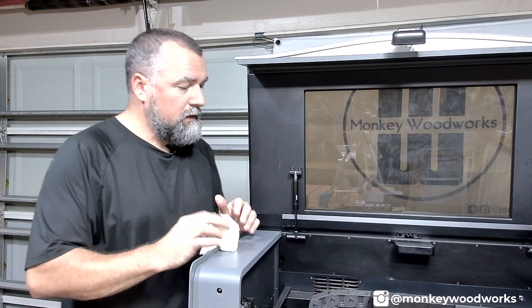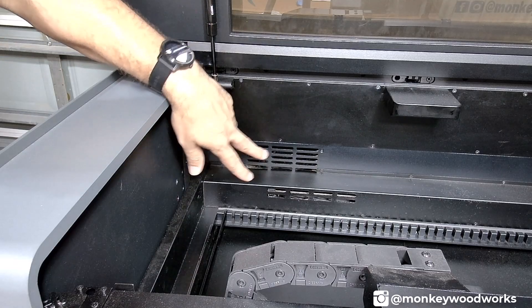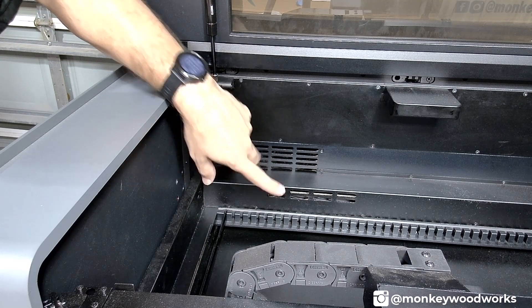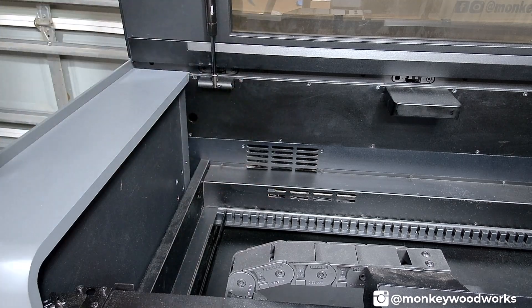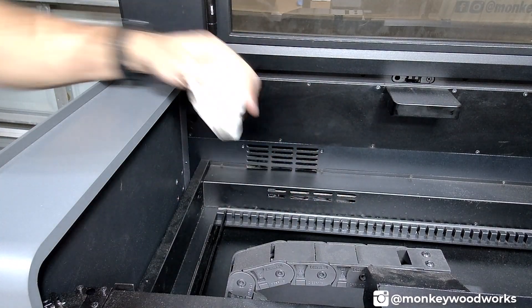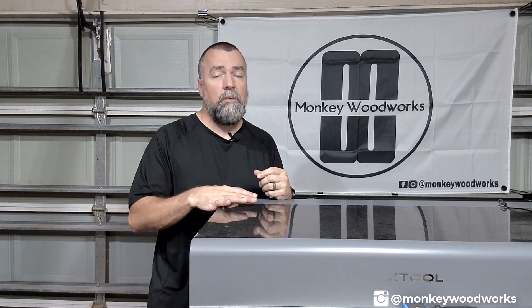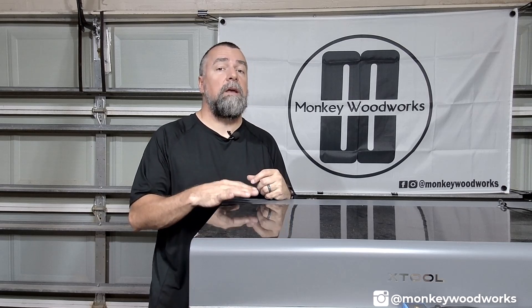We have all that cleaned up so far. One thing I failed to mention was the back exhaust area. Back there are exhaust vents, and you definitely want to make sure you keep those clean — spraying your rag down and wiping them out. So we've cleaned the mirrors, the lens, the interior, and the exhaust. Now let's flip over to the back and clean the exterior fan. Keep in mind you do have to remove a part of the P2 that hasn't been mentioned before, but the fans are going to get built up with gunk and will need to be cleaned.